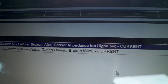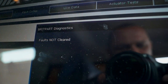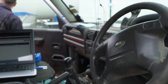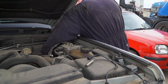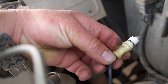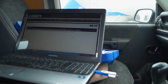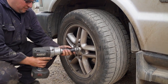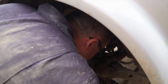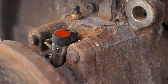I do have a problem with the wiring rather than an air gap. What's also confirming this is that the faults will not clear, which means it's persistent. The vehicle is owned by Brian Rust's haulage company, and one of his fitters has been assigned to change the ABS sensor on the front wheel. We did check it and unplugged it to make sure another fault didn't come up on the readout - when it's unplugged, it's saying exactly the same thing, so we've confirmed it's that side. With this model of Discovery you have to remove the calliper, and also the disc, so you can get to the sensor which is fitted into the swivel housing.